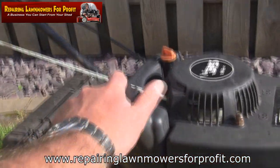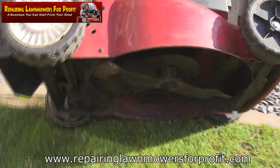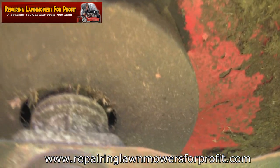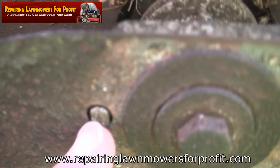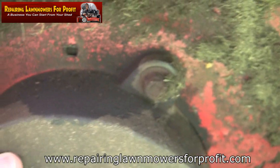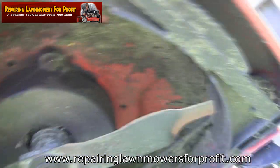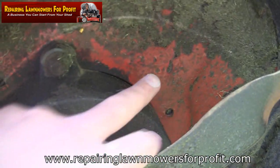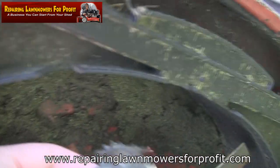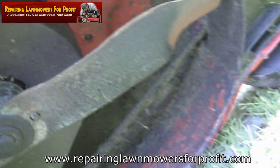I'm just in the middle of a water pistol fight but I need to take the blade off this mower to clean out this guard underneath. I'm going to take the plug off first. It says to tip this machine backwards, but as long as there's not much fuel in it, tipping the carburettor side up should be okay. Just get under here — make sure these pins are on the blade properly. I want to take the blade off so I can get this guard off under here. You can tell it hasn't done a lot of work because there's not a lot of grass really stuck to the underside — this just wants wire brushing off.